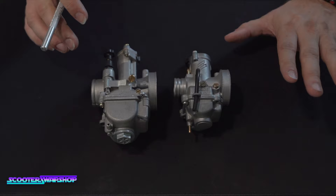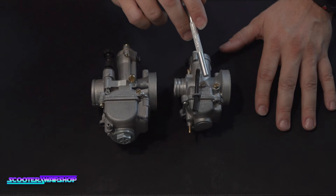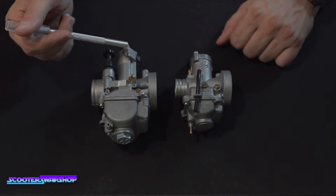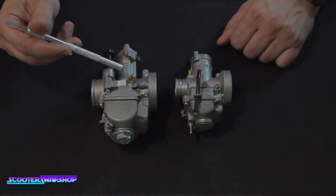The very first thing you need to do is get the bike running — it may run only at super high idle, that's fine; we'll adjust from there. Get the bike started and adjust the actual idle screw. There's going to be an adjustment right where the slide is on the carburetor. You can flip the carb over and look around to find it. All this does is give you a little bit of throttle — it just adjusts where the slide stops.